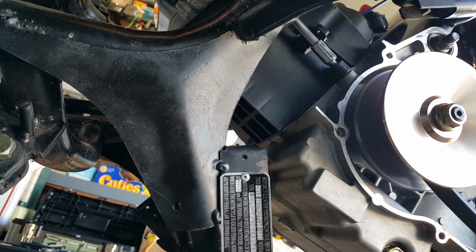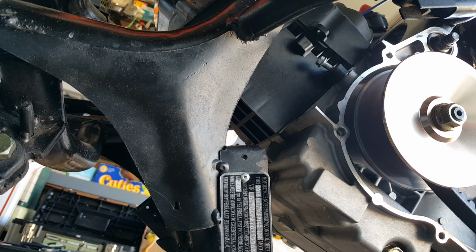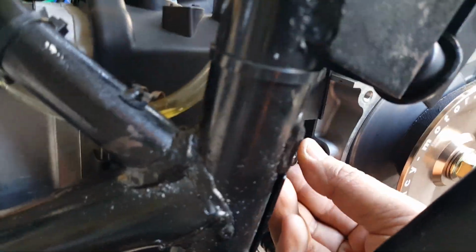And then also when we do a test run for our scooter, we can see if there's any kind of fumes coming from the cylinder head, which we're praying not. But I think we're pretty confident since we put on a new gasket, not a year-old gasket that's not even been retouched or sprayed on. We use the same spray that was on there because all the dirt and everything got into that gasket, that caused it to actually dry up. It's supposed to be wet, and now it's just messy. So let's see if our dry base gasket theory, as well as all the other gasket theory, doesn't cause any kind of intake leak or intake manifold leak, vacuum leak, or exhaust leak.